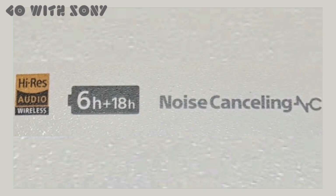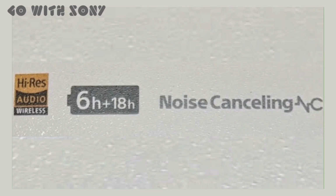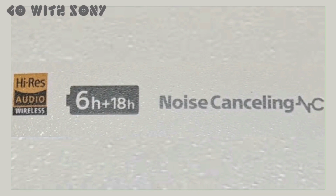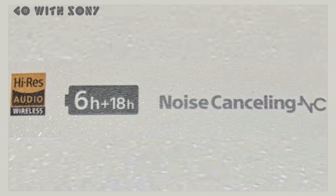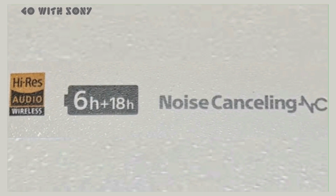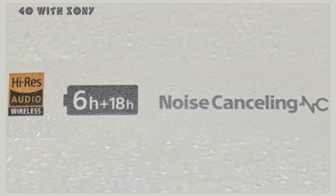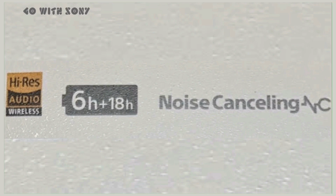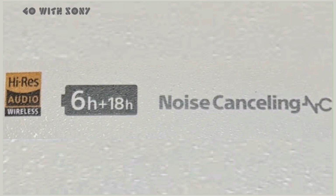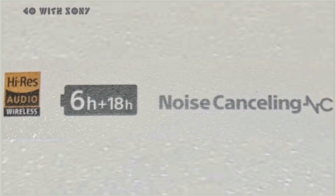Codec support. Both AAC and SBC will be supported. The presence of the high-res wireless logo suggests we will have LDAC support. Qualcomm's aptX is unlikely, because Sony has their own high-res codec. It is unknown if LDAC support will be all 3 versions, 330, 660, 990, or be limited to 330 as what I was told in 2019.